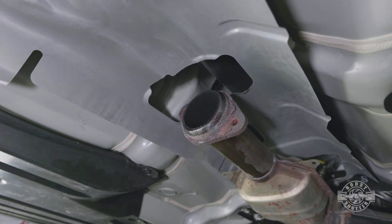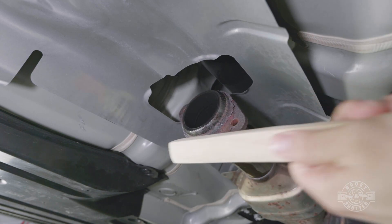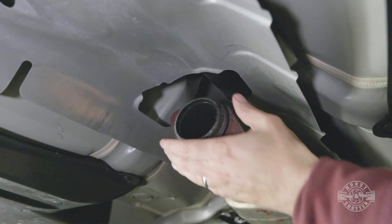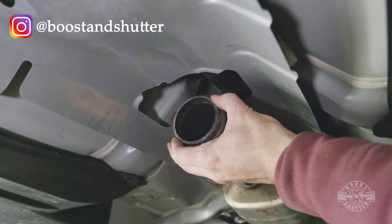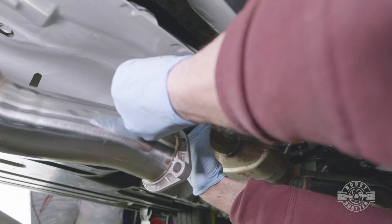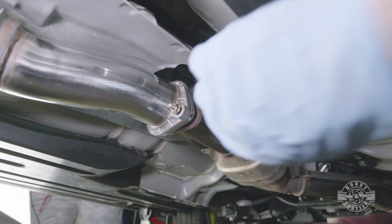And this right here is where that adapter is gonna go. I have some rust around here that I want to get rid of — I can do that easily with a large brush. Everyone's exhaust will be different based on the age of the car and where you live. Now if your car is older or really rusted out down here you might consider getting a new donut gasket. You can see here mine is in good shape so I'm reusing it, but they are pretty cheap. With it out I can do a more thorough job of removing the surface rust, and then when I'm done I can simply put the donut gasket back. Now I'm using the hardware on the adapter kit. First put the bolts in and then the thick adapter that fits nicely against the donut gasket, and then the second gasket included in the adapter kit. Loosely secure everything in place with the two nuts — we'll do this by hand and then we'll torque it in a second.